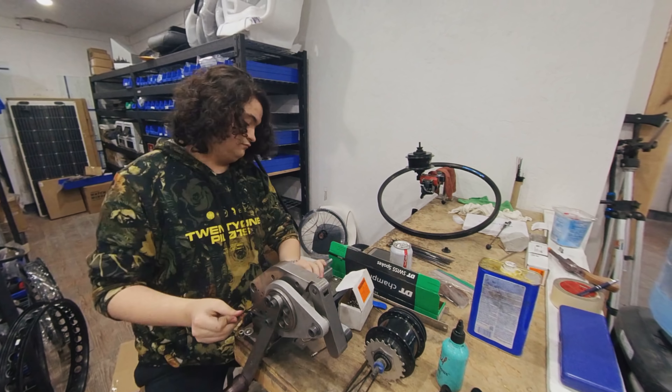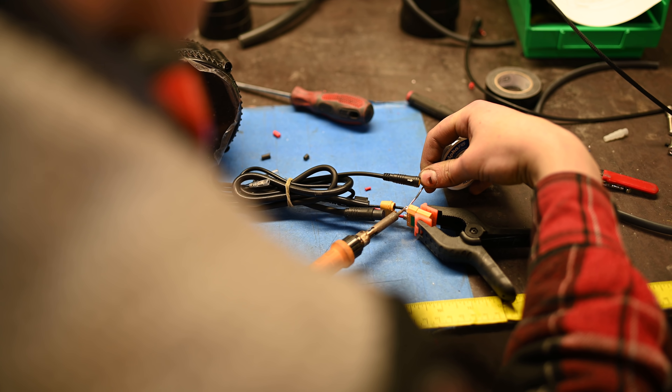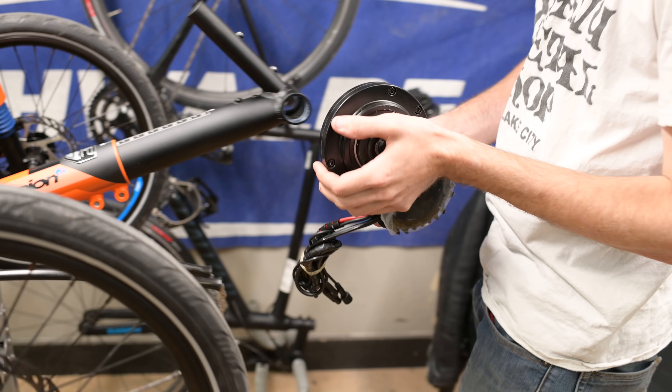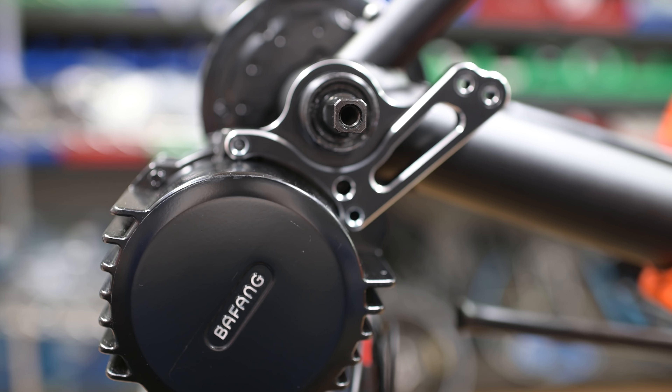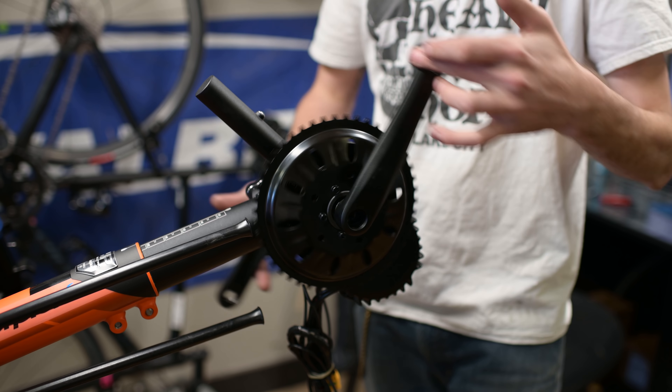While Henry took care of the wheel building, Ben was busy soldering up the motor kit so Louis could get it installed. There are various motor systems that can be added to a trike, and one of our most popular motor upgrades is the boom-mounted Bafang motor. The Bafang motor replaces the front crankset gearing and runs power through the chain to the rear gears, much like a car uses a transmission. For this machine, we'll be using a 1,000-watt motor and securing it under the boom with our UT Custom Torque Arm. The cranks attach to the motor directly. There's a freewheel-type mechanism integrated into the crank, which allows the motor to spin while your feet can rest on the pedals. There's also a cadence sensor inside the motor that senses how fast you're spinning and adds assist based on the setting chosen on your console.